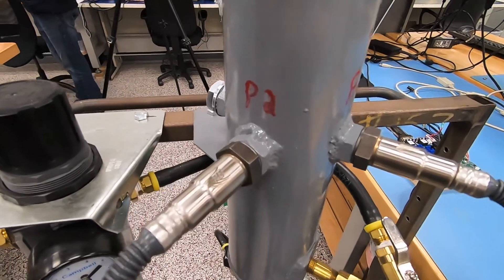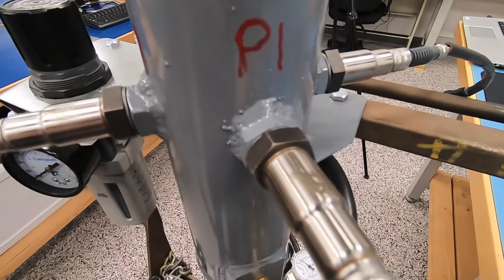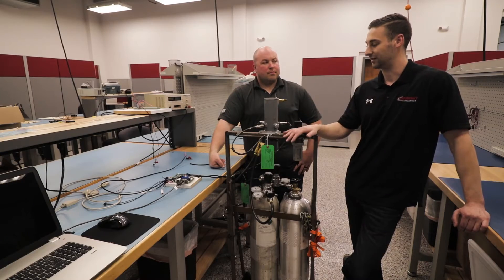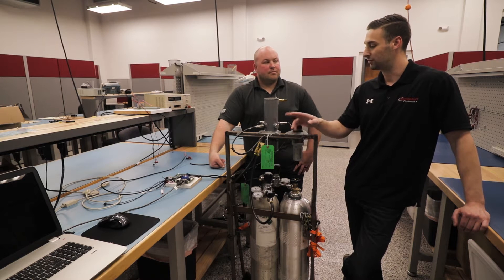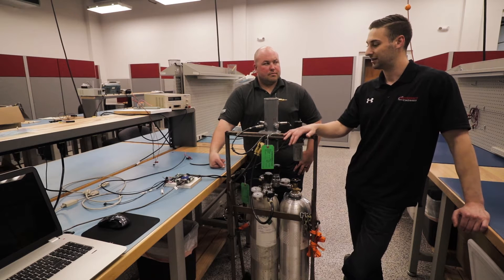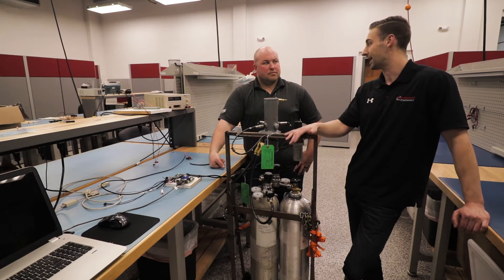So the main thing with the controller is it has to drive the sensor - the current needs to be controlled through them. There's a lot of different stuff that goes on to driving these sensors, but also driving the heater circuit. There are really two things being controlled in here, and from that you can figure out what your AFRs are going to be.